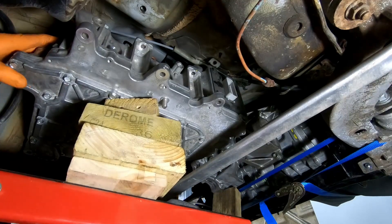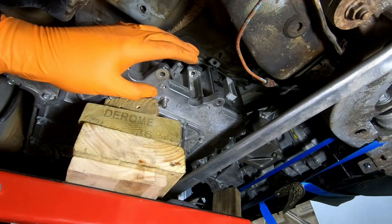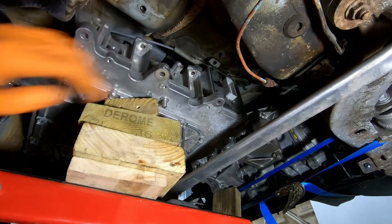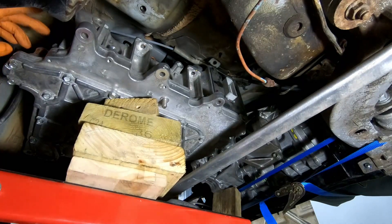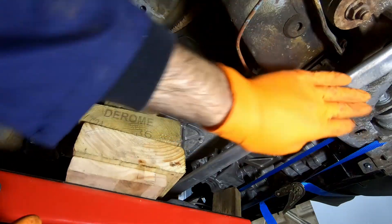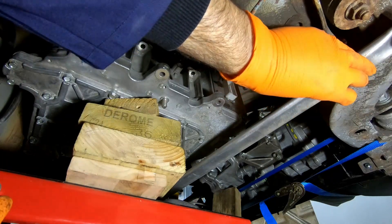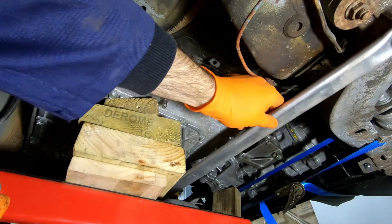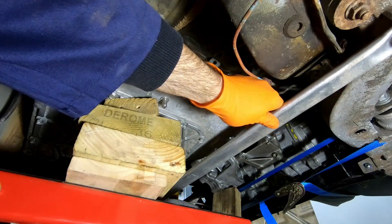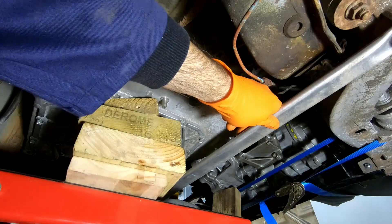That's pretty cool — it's almost like it's made for it. I've got access from what I can see to all of the connections. We've got our data connections, we've got our DC contacts on the bottom, we've got AC up here, and we've got our input and outputs for the heating. Basically all still accessible, which is fantastic. The cross member here which parts suspension clears more than adequately. What I'll probably do is create a slightly beefier version of this out of steel to give me something I can use as support and use that to hold up the inverter.